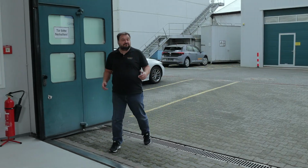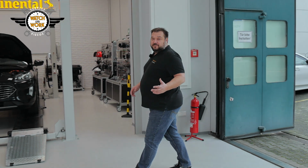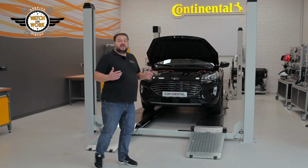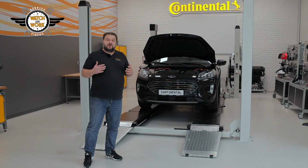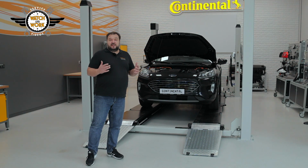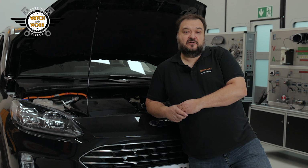It is becoming increasingly important to save fuel and protect the environment, and vehicles with a mild hybrid drive system are able to do exactly that. These models usually have a belt-driven starter generator under the hood, such as the 48-volt EcoDrive system from Continental. This achieves fuel savings of around 15% in modern hybrid drive systems, resulting in a reduction in CO2 emissions too. Such technologies have been on the market for a number of years now.